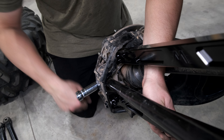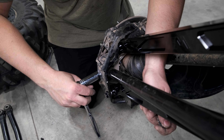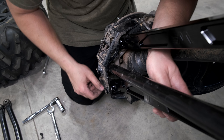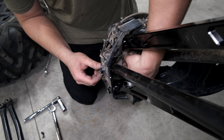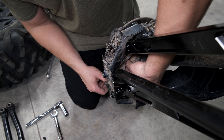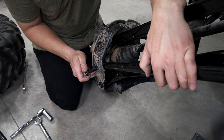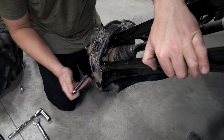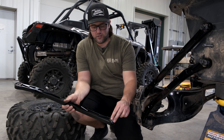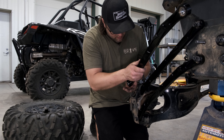Grab the new one — the ends are different. This end has the kicker in it, that's for clearing this. And this end has kind of a droop shape to it, and that's to clear the inside at full suspension drop. Put in just the bushings on the outside. Fish that in position. Have the bolt hovering in there and get your washer back in between the bushing and the bearing carrier or hub.